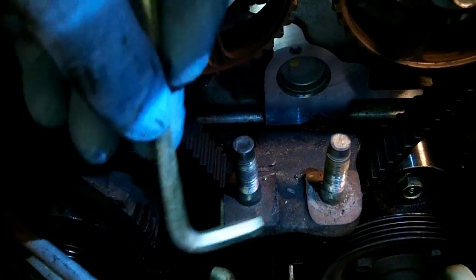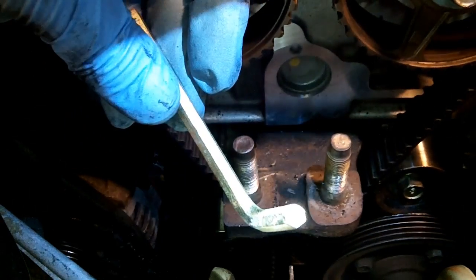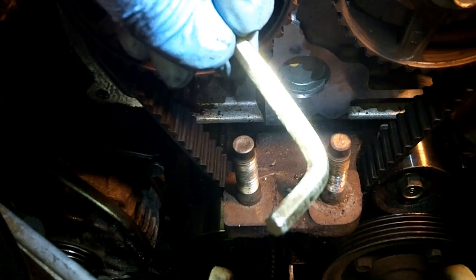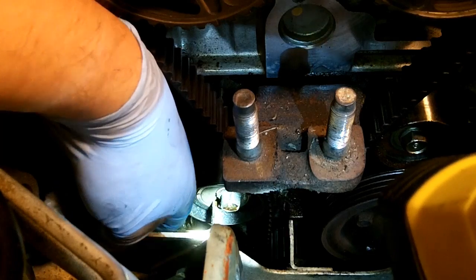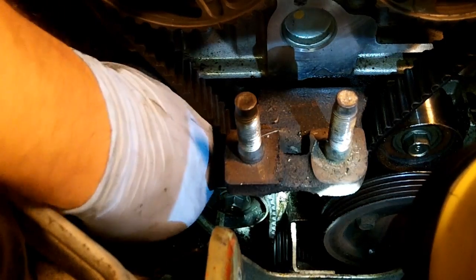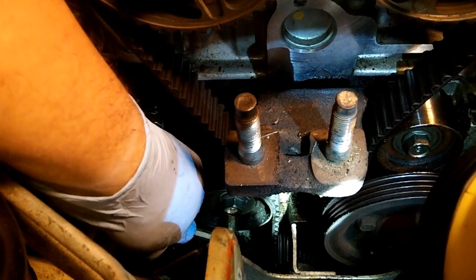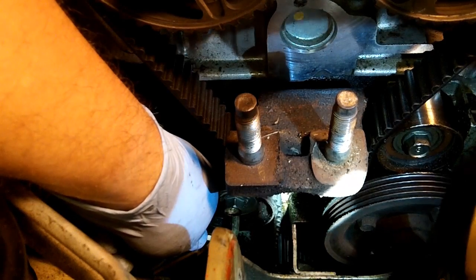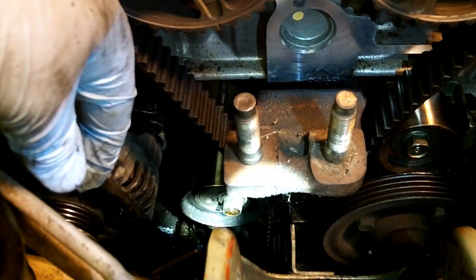You know those stupid keys that you get when you have to put together furniture and cabinets and shelves and crap? Well, I actually keep them. And today that hoarding has come to pay for itself. Now let's see how this does. Alright, now look at that. Check that out. So you see how on the right side that belt is either getting shorter or longer? So a really tight belt would probably look something like this, way over on that side, right? And that should be what the auto tensioner job is. Alright, so that's how you do tension.